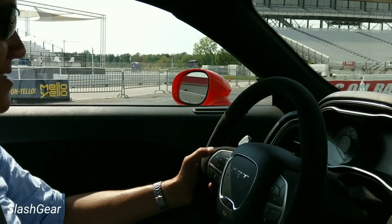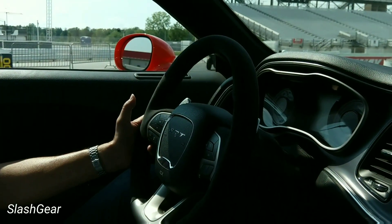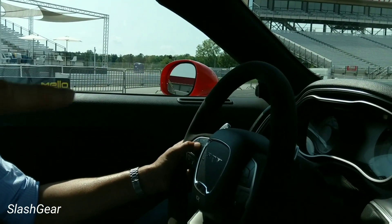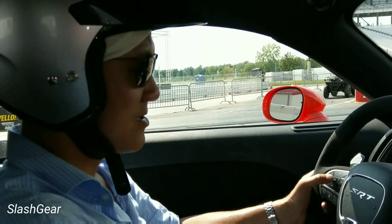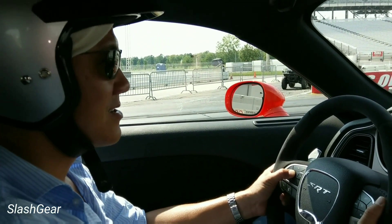Activate, good. Hard brake pressure, hard brake pressure, and then let go. Alright, here we go. Hard brake pressure till you get it up in the cluster. Now hold the pedal. Now go ahead and hold the okay button. Now let go of the brake and go ahead and do your burn-off.